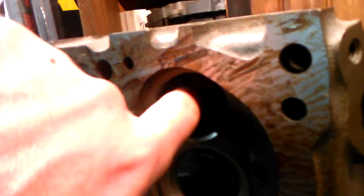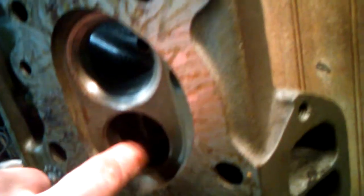He probably melted pistons to get molten aluminum and poured it in there — it can take several pounds. The advantage of this over just blocking the intake manifold is that you can pour it all the way down into the exhaust port and then port that, so all four of your exhaust ports are identical to each other. The end ones that don't have the extra port become the same as the center ones — you're going to pick up more performance. That's why they do it, and that's part of a stage three or stage four cylinder head modification.